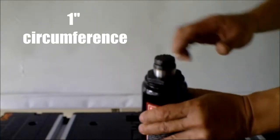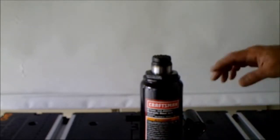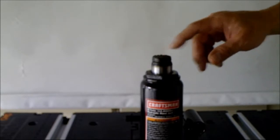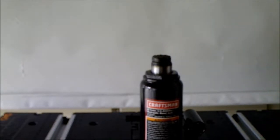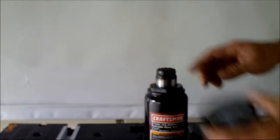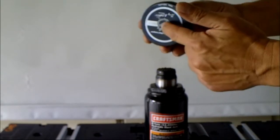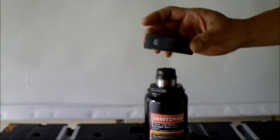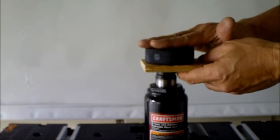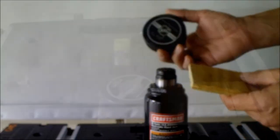With bottle jacks you have a very narrow surface area, and what that means is that when you jack up your car all that weight is focused on that small area, which can lead to slightly dented frames. What I like to do is evenly distribute the weight by using a hockey puck. You can't just put the hockey puck on top because the narrow surface area will push against it and distort it, so I'm going to use a half-inch piece of plywood as a base and glue the hockey puck on top — that way the narrow surface area won't touch the hockey puck and won't cause any distortion.